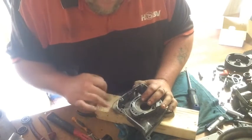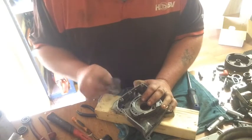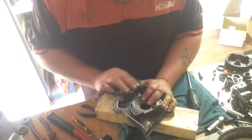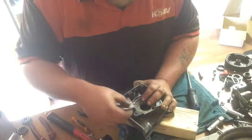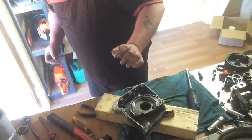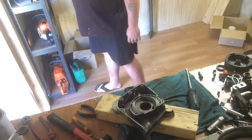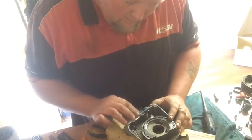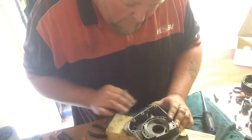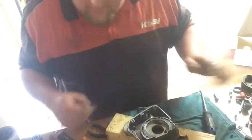So I've got to put the MS260 oil pump on it, change the sprocket and the worm gear. Well, I don't have to, I've got another 024, they're all genuine, untouched, it's a red lever I think. Whereas mine has an aftermarket piston and rings in it. It was only lightly scored. It wouldn't idle, so I just thought I'll rip it apart and give it a rebuild, which I did.